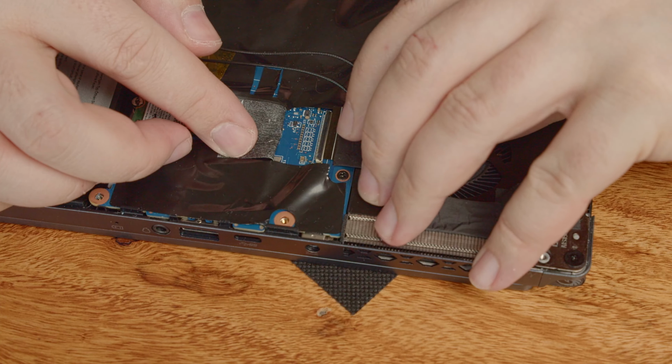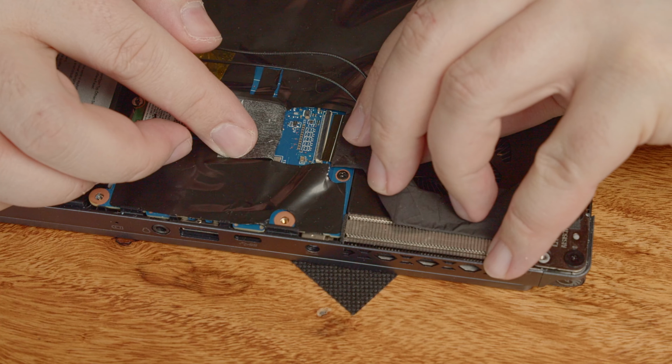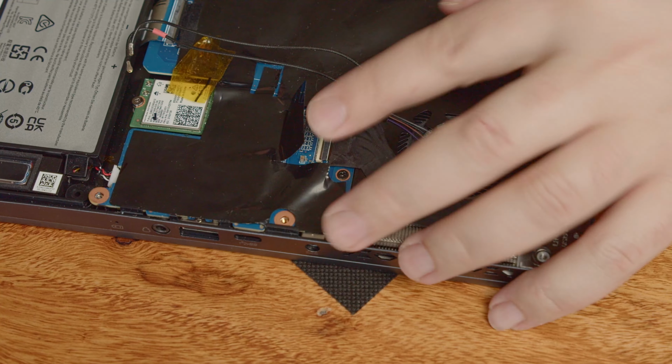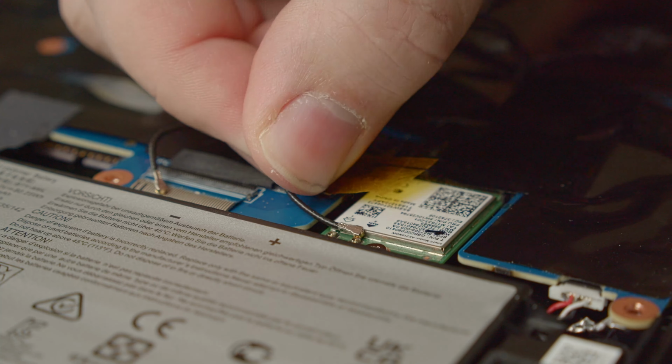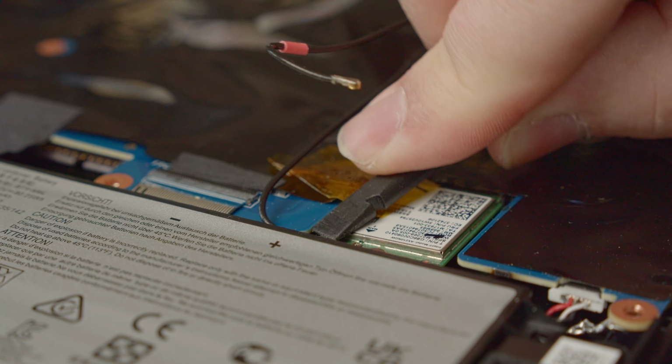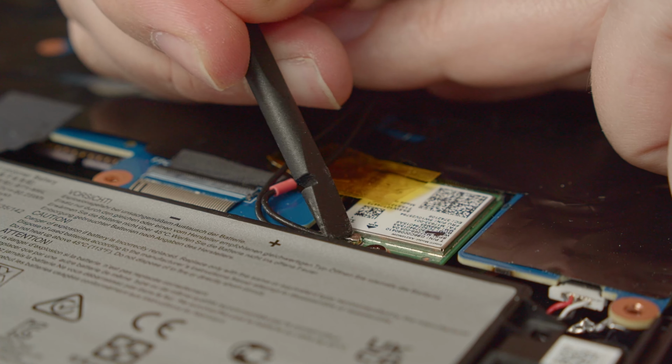They also have to be in the right order, so make sure the cable with the red ribbon is plugged into the main socket. Place it on the connector and gently push it down with your spatula, as fingers won't really do the trick here. Ask me how I know. Also, there's no audible click or any other confirmation if you plugged it in properly, so you have to rely on hopes and dreams at this point. Or give them an ever so tiny tuck to check if they are properly in place.